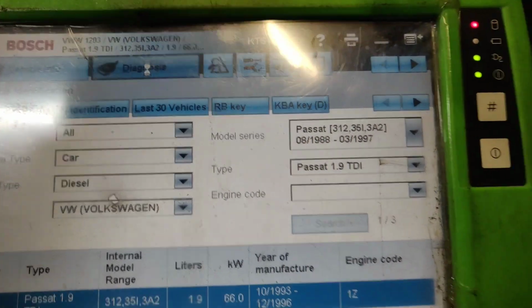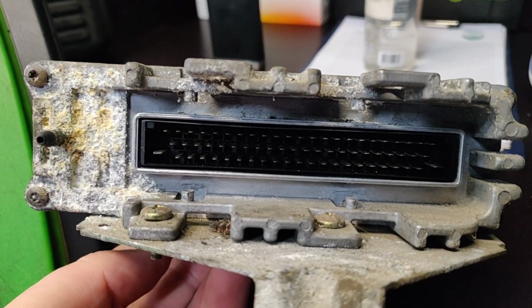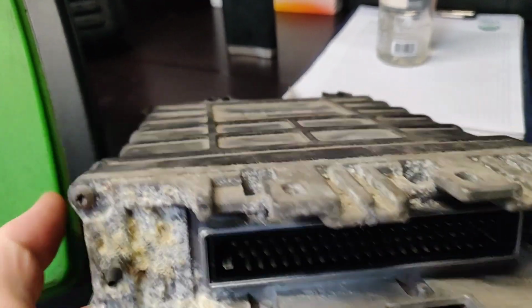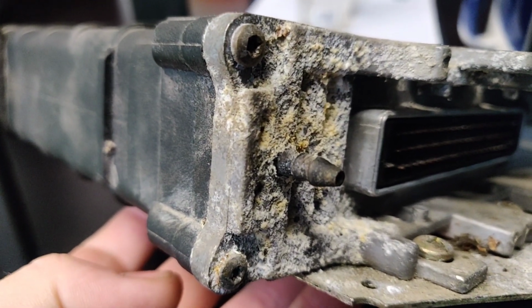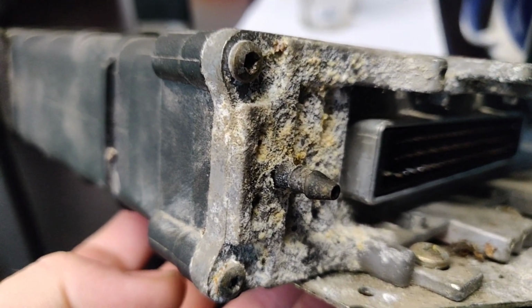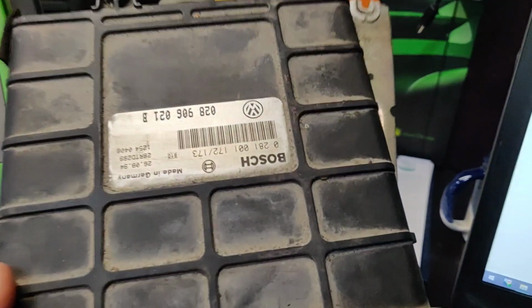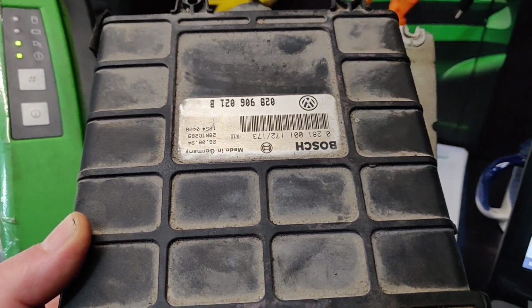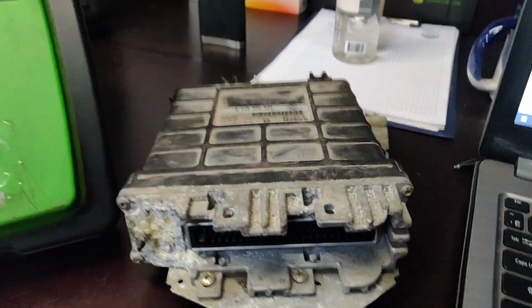So we go inside. Actually, what we need to do with this electronic control unit, the owner wants more power, so we need to do a chip tuning. Yes, it's funny, but it's possible. Look, there is a MAP sensor in here, the intake manifold pressure sensor, basically just a pipe going in, but we see inside when we open it up. We need to resolder the flashes, and what we need more, we need IMMO off, because he probably lost the key, or I don't know, but he's asking for IMMO off.